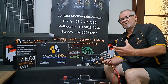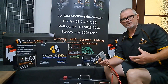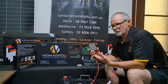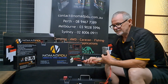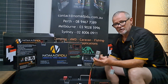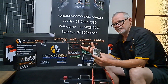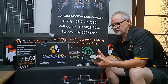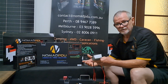DC-DCs like these can be used to step up or step down voltage — so rather than running two batteries in series, you can step up to 24 volts. We use this when running a 24 volt air conditioner. You plug this into your normal 12 volt system, step it up to 24 volts, and run a 25 amp unit — that gives you enough amperage to run a 24 volt rated air conditioner. You can also step down to 5 or 6 volts if needed.